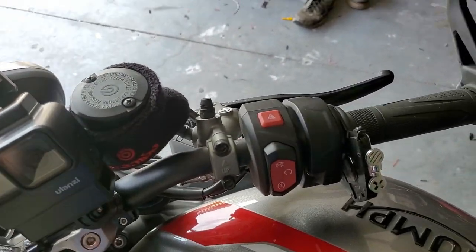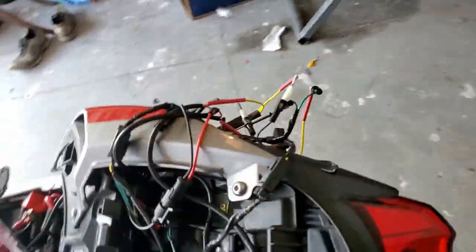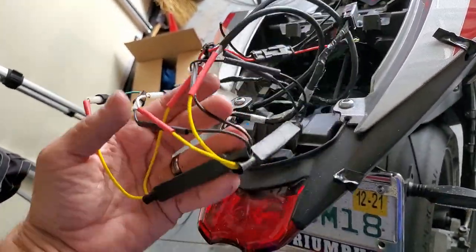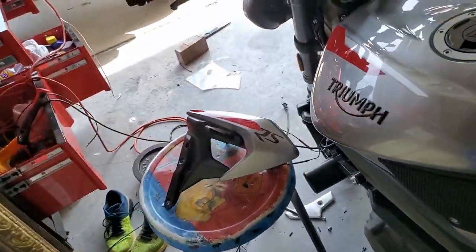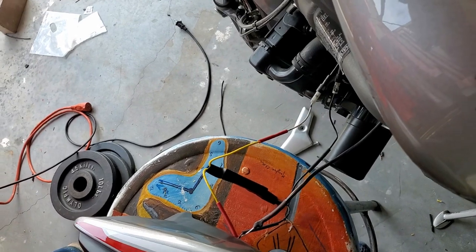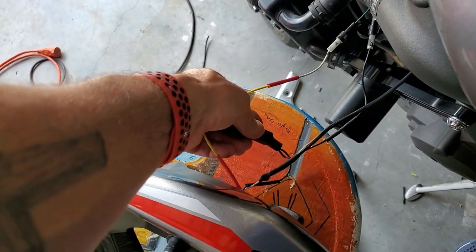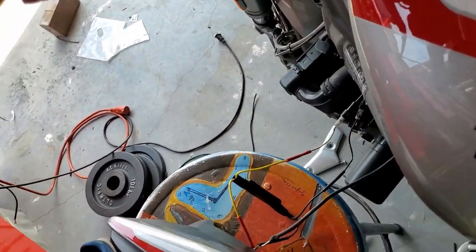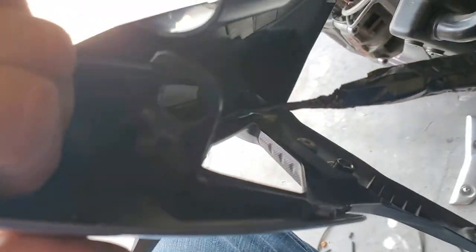The front right works independently but doesn't work when the hazards are on. I've got one last resistor to put over there. The only concern is this is just a rat's nest. I left a lot of wire because if I leave short wires everything is going to be up here, so I left a lot of wire so I can bundle it and tuck it in the front. I tried some other Sylvania resistors with higher resistance and they were getting hot — these aren't getting hot, so that's a good thing. I just have to tuck everything back together, heat shrink it, and it'll be working.